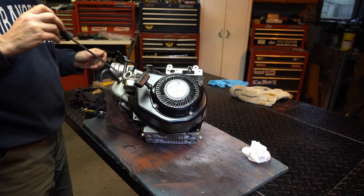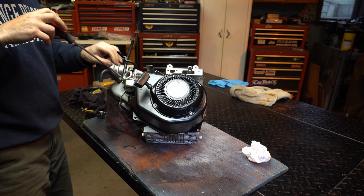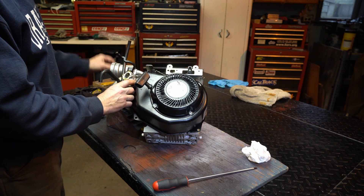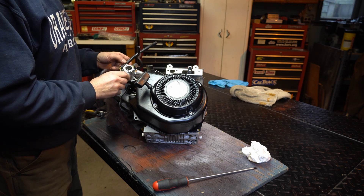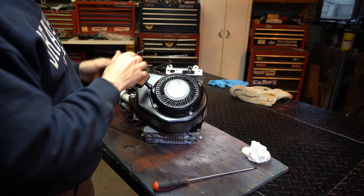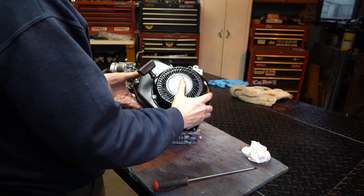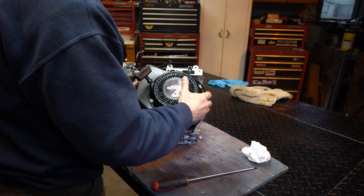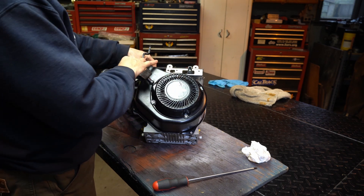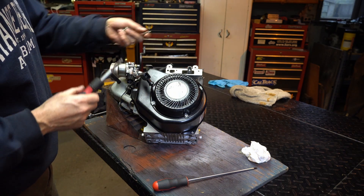We're going to pull the carburetor out of our way — we're not going to have to disconnect everything because we're not at that point yet. For a how-to on installing a carburetor, generally speaking this would already be in place. So now I'm just going to kind of toss it back. There are these little fingers here — you kind of have to get all that in together at the same time. It slides in like that. Those fingers help to hold the upper steel guard.